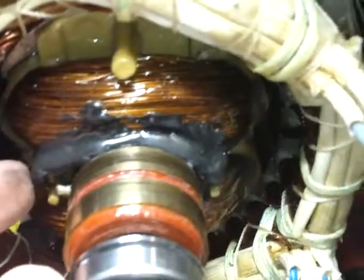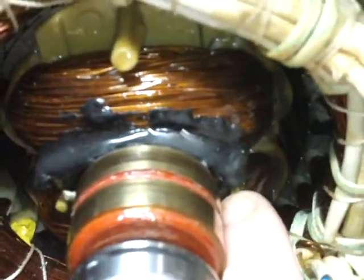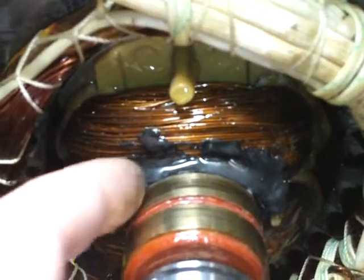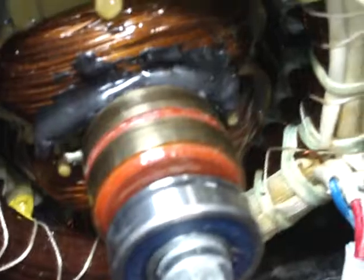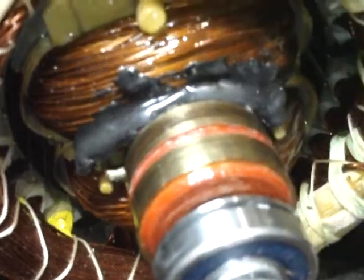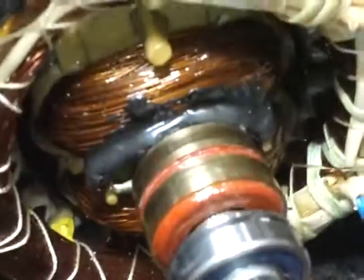I'll show you the repair here. I just used some good quality insulated wire and ran from point A to point B, then I used some good epoxy to epoxy the wire down so centrifugal force won't pull it away from the mounting points. This thing spins pretty fast — 3,600 or 3,000 RPM, I think they turn about 3,200 to 3,600 depending on where you set your cycles.